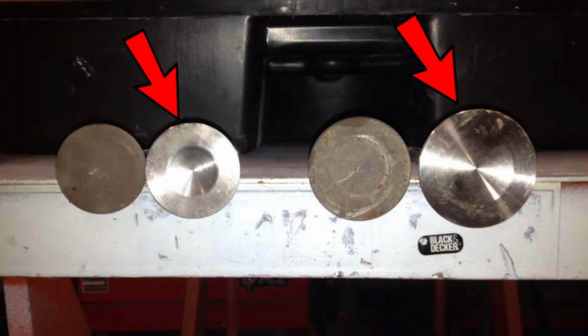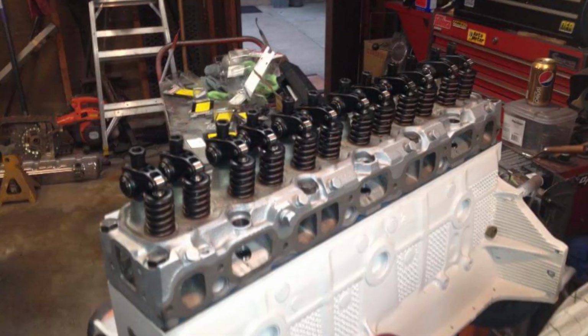So, I put bigger valves, roller rockers out of a big block Chevrolet in it. They fit nice, but they don't fit in the valve cover, so you gotta buy a special valve cover. That was all Comp Cams stuff, right? Comp Cams valve springs and stuff. Yep. So I put a mild cam in it. It's only 515 lift, which is fair. It's got a nice little lope to it. And put a 4-barrel on it.